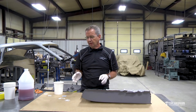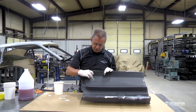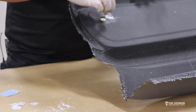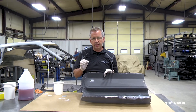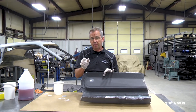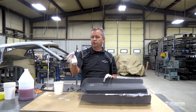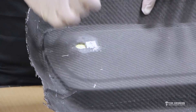I'm going to mix up some resin, following the directions to mix it to the right ratio with the catalyst. I'll take my brush, put some resin in to fill up this hole, then dab it down on this stranded chopped mat and pack it into the hole. Once you get it wet it'll be easier to work with — take your brush and pack it down in there, and even use a little pick or round punch to push it down into that hole. Get as much fiber in there as possible, because you're going to be drilling right back through that same hole and don't have the option of moving to a different location. Pack that hole full of chopped mat and resin, then take a little square patch and put it right on top, and once that's wetted out, put another one on top of that.